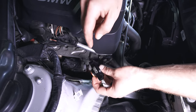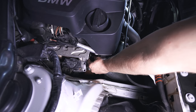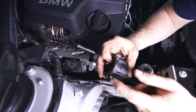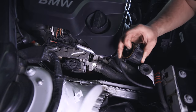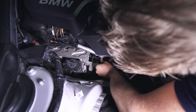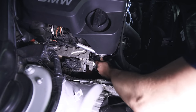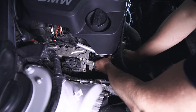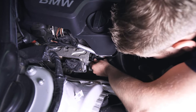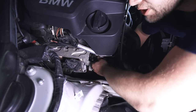Once you've lubricated the piston with a little bit of oil, start to install this. Make sure the little notch is in the top left — it should say GFB on top, but just look for the notch as that's really the true sign. Put the spring in, put the plunger in, making sure the notch is in the top left. If you put it at a downward angle it should pop pretty much into place. Then apply pressure and try to get one of the bolts threaded — that'll hold it in place so it shouldn't pop apart.